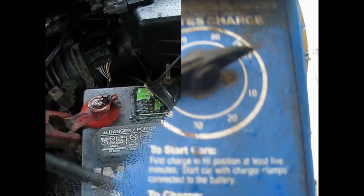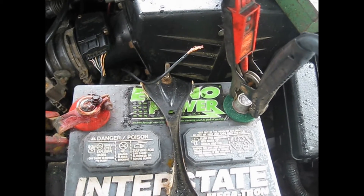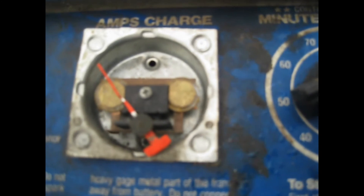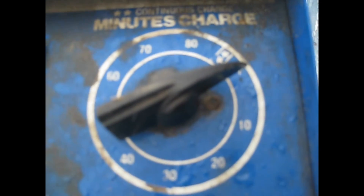The cells in the battery don't like charging very fast at a higher amperage, so you want to charge it on medium or low. Next, attach your positive cable to the positive side, negative cable to the negative side, then turn on the charger. You can set it for 30 minutes — half an hour. It shows you the amperage rate and the voltage. When it finishes charging it's going to cut off by itself; it won't overcharge your battery.